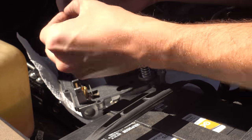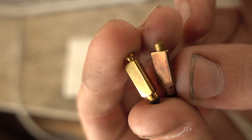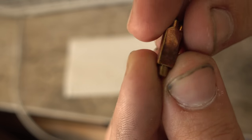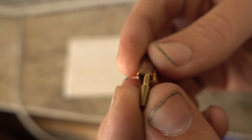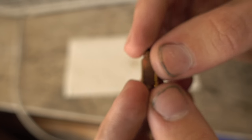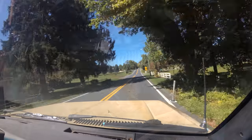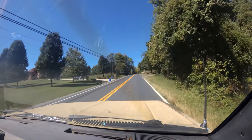The rebuild kit I used for this carburetor came with two types of needle valves: the traditional style and the off-road style, which is spring-loaded to help prevent flooding on rough terrain. When I set up the carburetor, I used the off-road needles and the specs from the off-road needle instruction manual on Edelbrock's website. The older instruction manual for these off-road needles has a different float setting, and I came across more than a few people having problems setting their floats for these off-road needles. So I swapped back to the one-piece style of needle, set the floats for that, put it all back together, and there we go. Mystery solved — that lean stumble is gone. The bowls were simply running out of fuel.